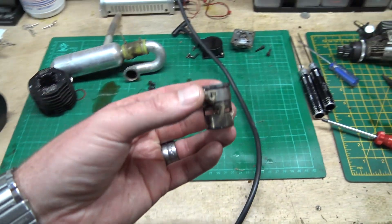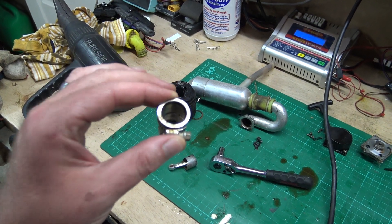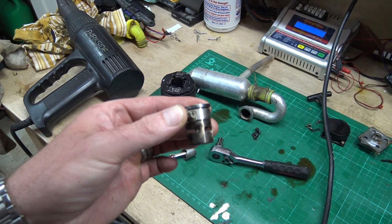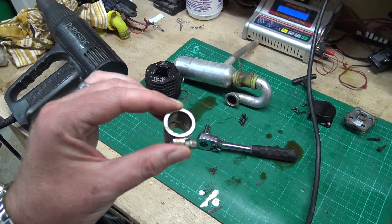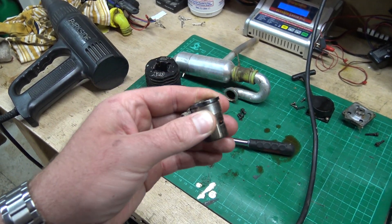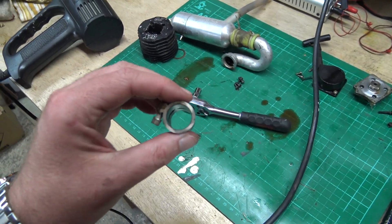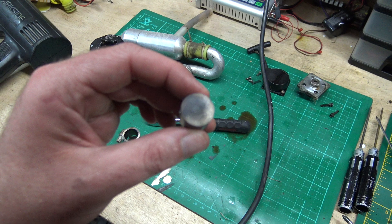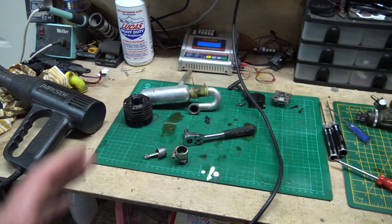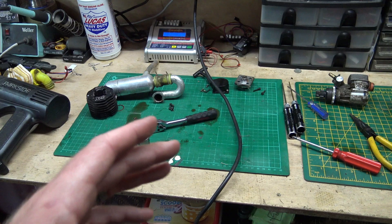So I just had it loosely in the vice - just enough to hold it so I could heat it and get my ratchet on the jubilee clip. This is under quite some tension now because I've been heating it up gradually, doing the jubilee clip up a bit tighter, letting it cool slightly, then heating it up some more. The jubilee clip then goes slightly loose again and I tighten it a little more. Then you just leave it to go fully cold, and the taper should be back enough to pinch the piston when it gets near the top.